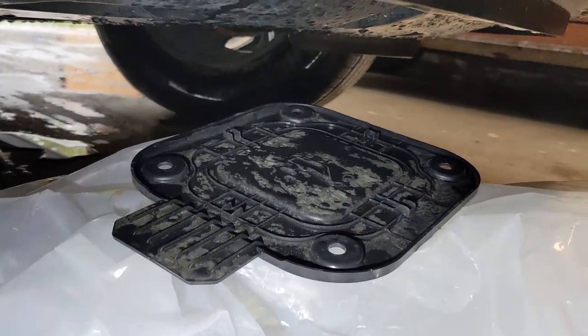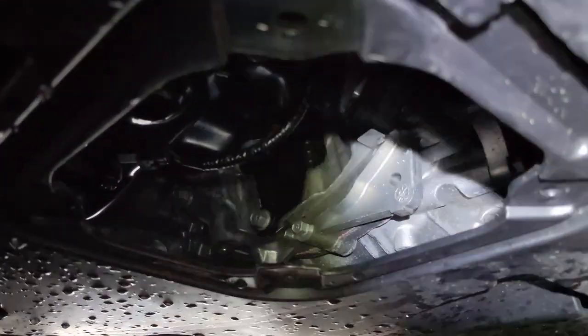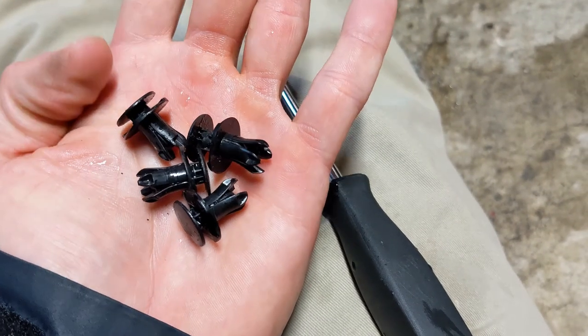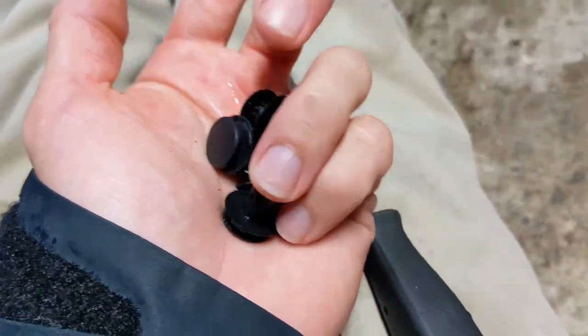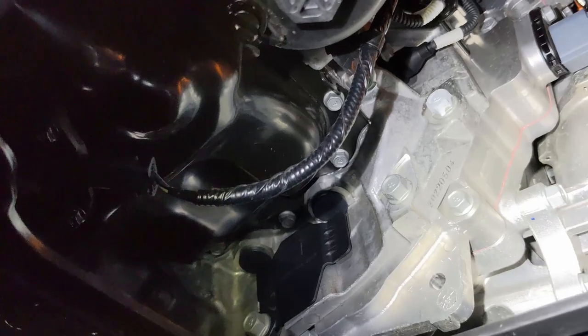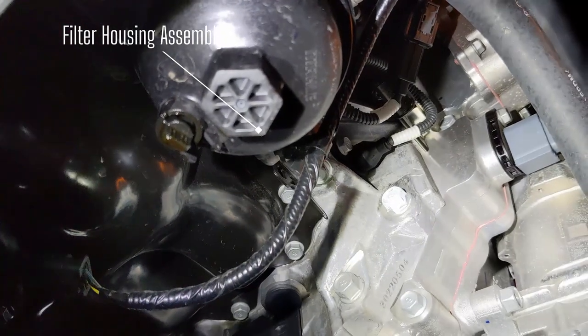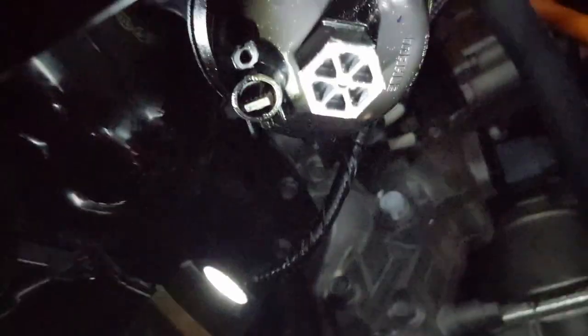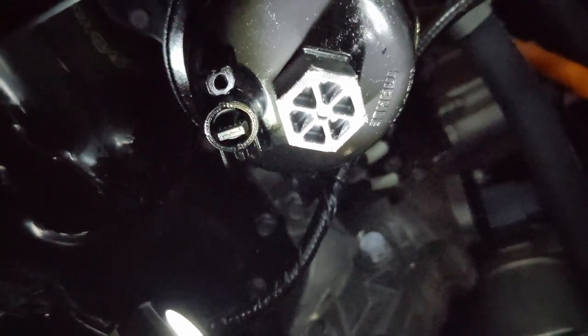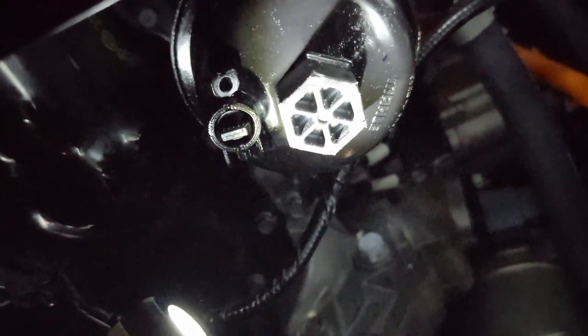First things first, you're going to need to take this cover off — it's located right here, quite close to the front side of the car, and you can reach it without totally getting under the car. To get that first panel off, really simple — all you need is a flathead screwdriver. It's this style of fastener: you pop it in there, pull down the top, and it slides right out. There are only four of them for that first panel. The piece right above is the housing for your filter — you'll also need to remove that. It does have a piece you can get a wrench around; it's a 5/16 wrench to spin that.